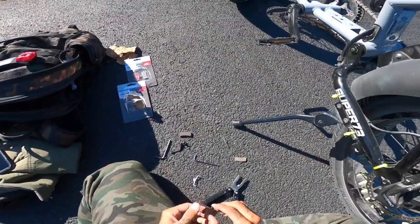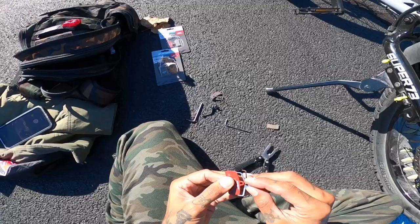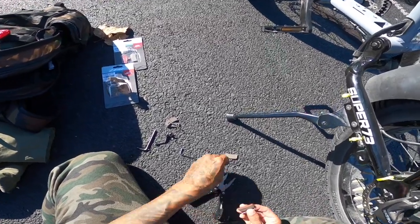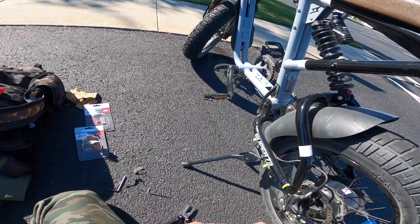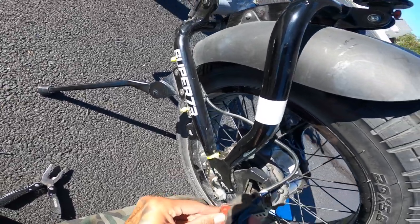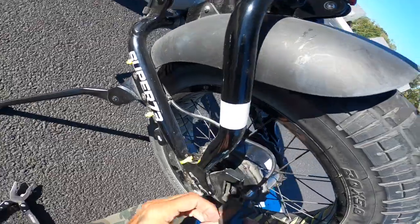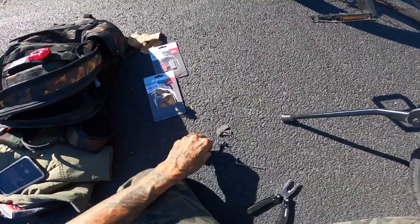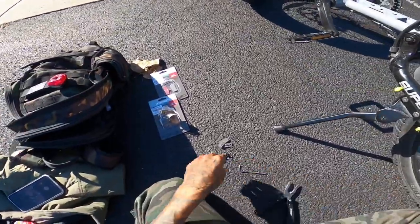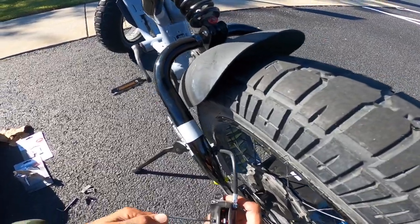They wore a lot of brake pad off. This little metal holder — you're going to want to put it on the inside, that's actually holding the brake. See how it's like exactly on the pad? Same thing with the other side. I like to kind of hold it so it doesn't slip out — keep it tight and then just slide it in there nicely. Get the little bolt, slide it right through. Tighten it up. After this I'm going to show you guys how to bed the brakes. So that's in there — it's kind of thin, it might not even fit.